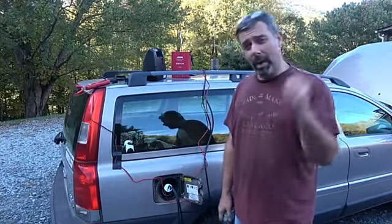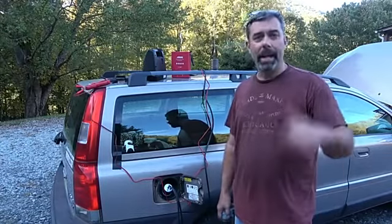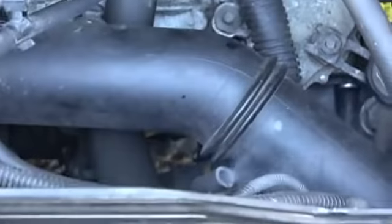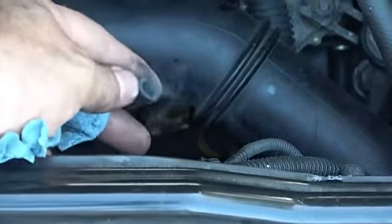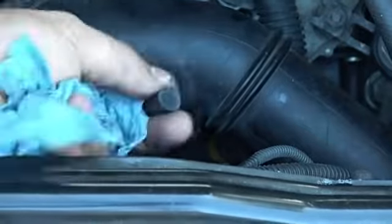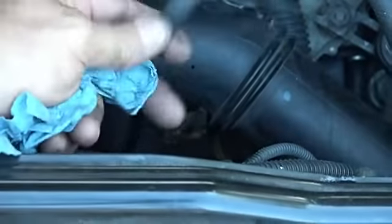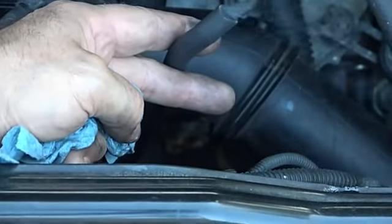All right, so there's no leak, but what I've done is I've gone ahead and unplugged the line that comes from the charcoal canister up to the purge valve, and I'll show you that coming back from here, we can find our leak. Might catch a wisp of smoke right there. There's our purge valve line that I've unplugged, and you can see, hopefully you can see, there you go. It's coming all the way through all those lines, and that's where my leak would be detected. So if this had a tiny little crack in it, I'd be setting EVAP codes, maybe purge valve codes, maybe leak detection pump codes, but in reality, I need a 2-cent piece of vacuum line. Pretty awesome, huh? Let's go back to the shop and wrap this up.